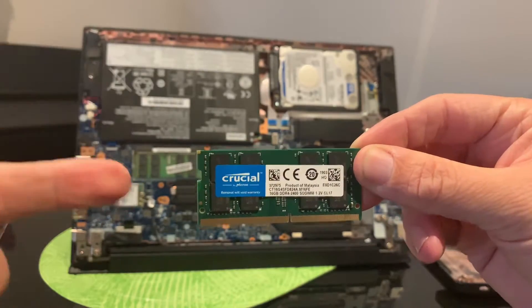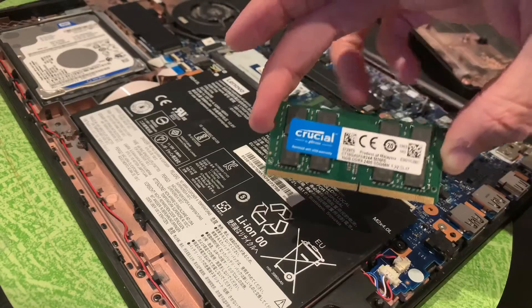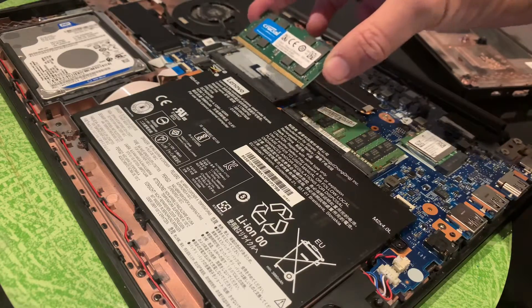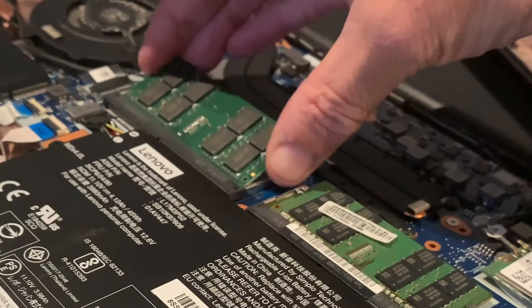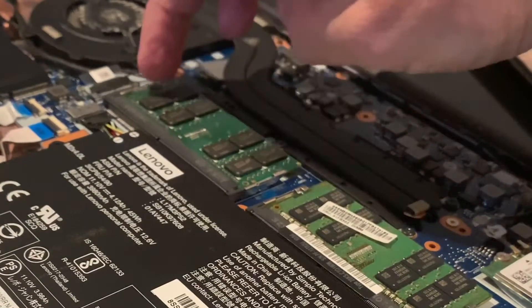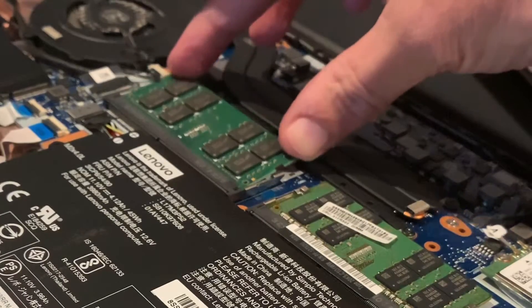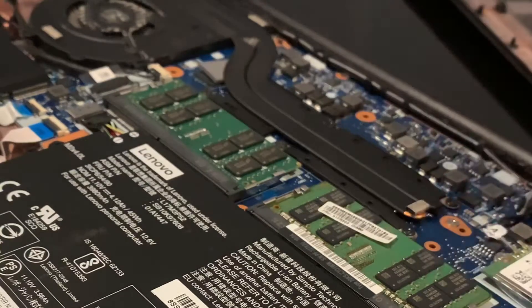If you're also in the market for upgrading your ThinkPad E-Series, there are links in the description to where you can pick up the right sort of RAM. If you've never installed a stick of RAM before, it's actually quite simple. You just need to line up the edge with the socket — make sure it's the right way around. There's only one way you can do it. Slide it in the bottom, apply a tiny bit of force, and it clicks down into place. There are two little clips either side that clip in. If you need to remove it, just flick those to the side and it pops up — it's a spring-loaded mechanism. That's seated and done.